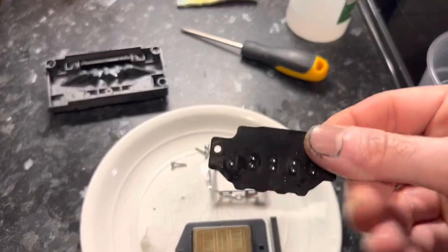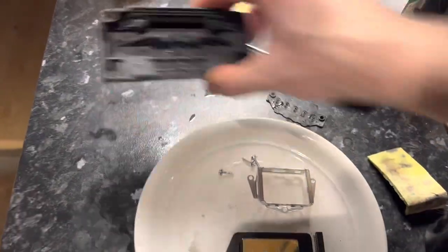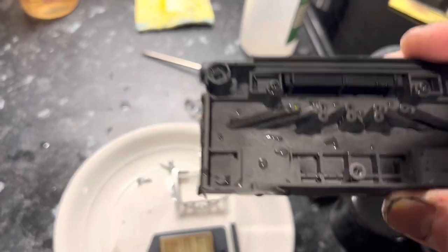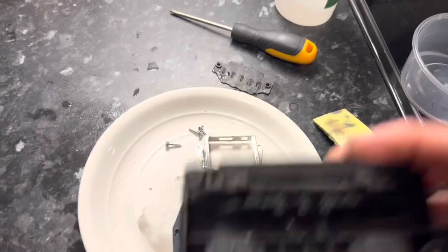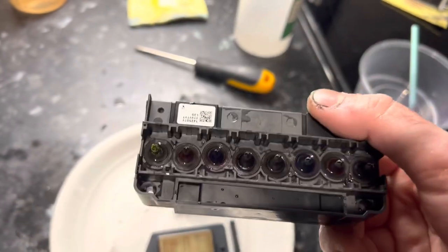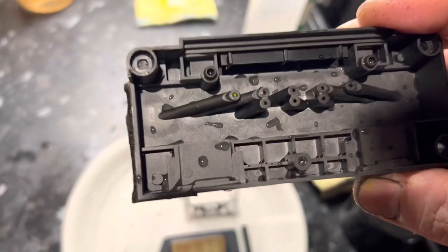I've cleaned the gasket. When you're cleaning the manifold, make a mental note if any of the channels are really hard to clear — you're going to struggle with those same channels on the actual head itself when you put it back together to reverse waterfall it. So just make a mental note and remember.